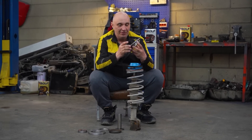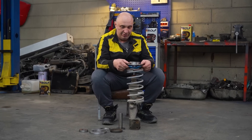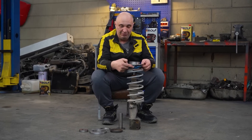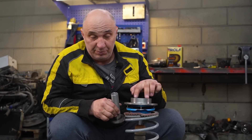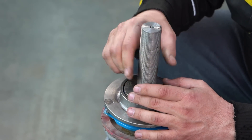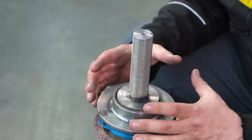Some people install spacers that are a good 35 millimeters thick, so this is fine. The mount on this strut contains a bearing, which allows the whole thing to rotate without any of the angles shifting around. This part is going to be assembled like it would be in stock form, except the studs are going to be pointing down and the nuts will be beneath the mount. Since we have a flat surface here, it'll happily slip under the strut tower without getting in the way. The bearing is shaped such that it partially pokes out, so we've made the spacer ever so slightly taller. In this spot, we're going to be welding in this big bolt-looking thing, and these components will be free to move around. Then there's the matter of securing the whole thing to the strut tower.